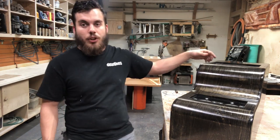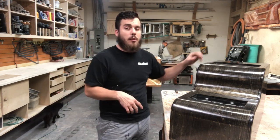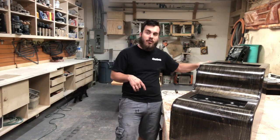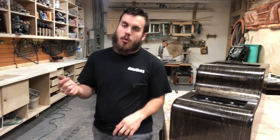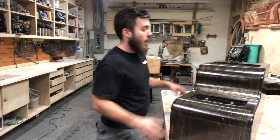Also on the top of this enclosure, it's got a plexiglass window so you can view the motor of the woofer when it's playing or just showing it off. The woofer is mounted towards the back, facing the back of the truck, and so is the port firing there. The port is tuned to around 32 Hertz.